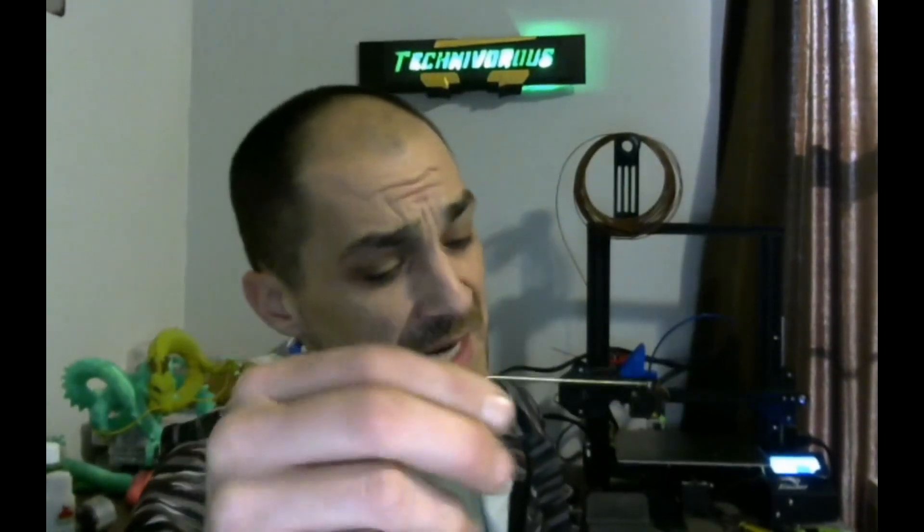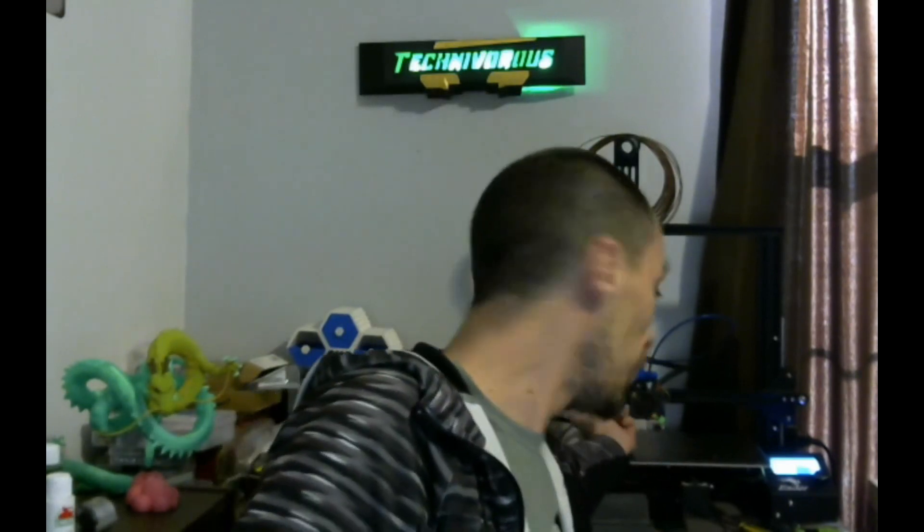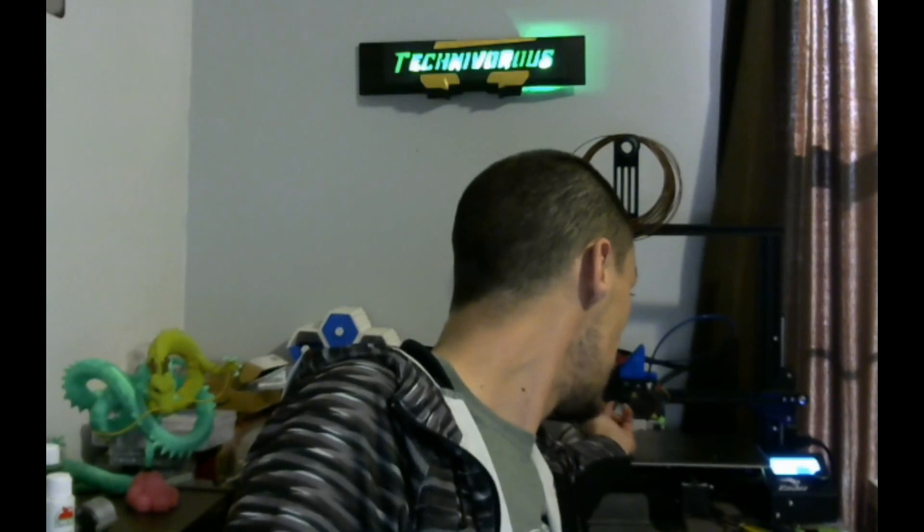A couple of quick notes about this technique. When using your Allen key, I am using the smallest Allen key available in my set. The second smallest that comes with the Ender 3 will also work, but only if you do not have the hot end fix in place. The other important thing to remember is: when placing your Allen key into the Bowden slot, you want to make sure you are leaving a gap between your hot end — which is super hot — and your bed. The downward pressure will not only keep it from extruding out the nozzle, but the heat can mar your bed, and forcing down when nothing can come out can cause damage inside the hot end. So you want to hold the gantry that the X motor is on and apply even downward pressure to force that clog out of the extruder. You don't want to be in contact with your bed — don't mash it all the way down. If you are having trouble pushing, heat it up a little more and give it a gentle push.